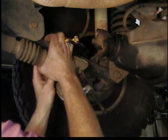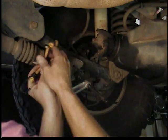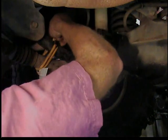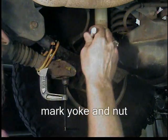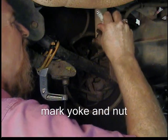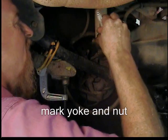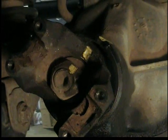You can see where it's been leaking around the pinion. It's not dripping-on-the-ground leaking, but there's plenty of lube out there. Next, I'm going to take that same paint pen and mark the yoke and the nut. I'm also going to take note of how deep the nut is on the shaft so I can get it all back in the same spot.